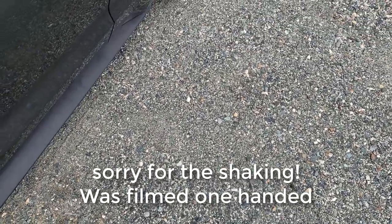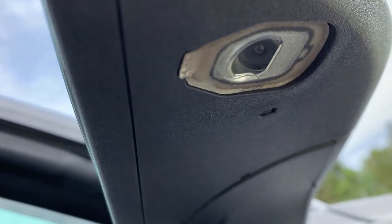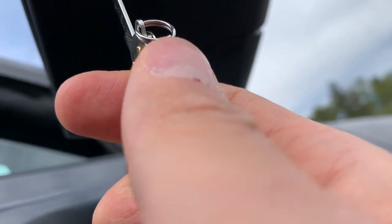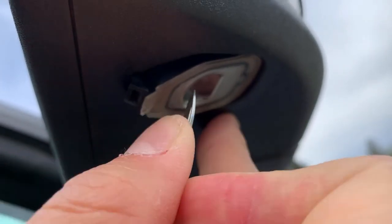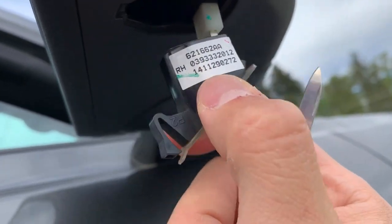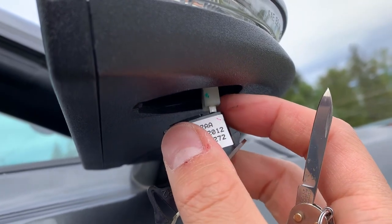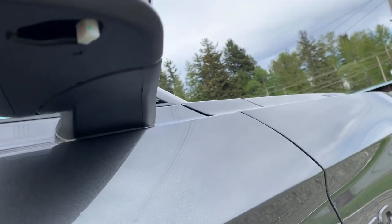Let me show you how to do that — I'm going to be using a small pocket knife here. I want to place my small pocket knife right where that snap clip is and then push inwards. By pushing inwards, the lamp bottom pops out and then I can just pull the whole assembly out. It's connected with two electrical prongs right there — just remove that.